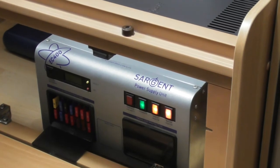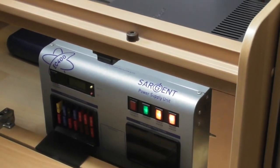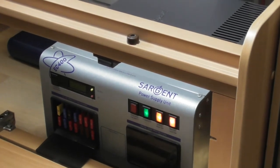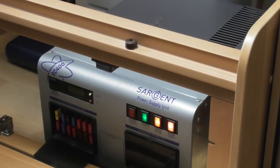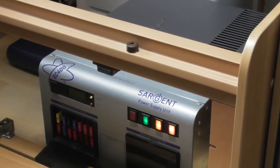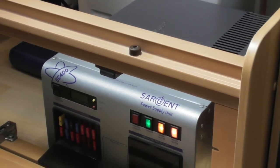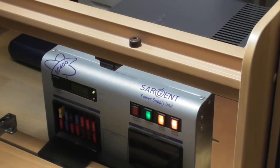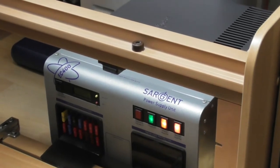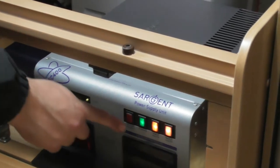But back in the olden days with the older caravans, fair enough. If you left it plugged in for long enough, you'd blow the battery up eventually, because they were all old, antiquated systems. But now in these new modern ones, you can quite happily leave it plugged in constantly and it won't do any harm, because the battery charger will literally just switch on and off as such when it's coming in and out. So system shutdown, as I say, isolates your 12 volt system, but if you're keeping it at home, I wouldn't worry about that because you can just plug it in on your drive to keep the power charged up. Moving on down, we've then got reverse polarity.